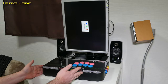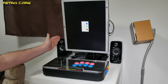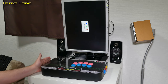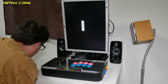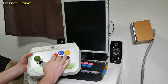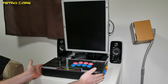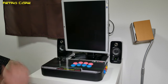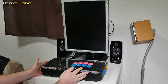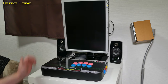Are you ready to see the stick in action? I've got it connected up to my Raspberry Pi 4 here, which I use for playing vertical shooters, or Tate shooters. Before I used to use this joystick down here, which was an Xbox 360 Hori stick — again it's got Sanwa buttons, it's fully customized, it's also a Sanwa stick. But I wanted something a bit more substantial for the arcade stuff, and this thing does not move — it's rock solid. I had to go into the configuration files and delete some files related to the Hori stick because it wouldn't save the configurations for this, but once that was done it was not a problem. So let's boot up the Raspberry Pi and switch on the power right now.